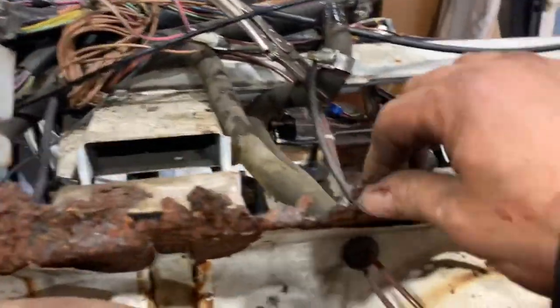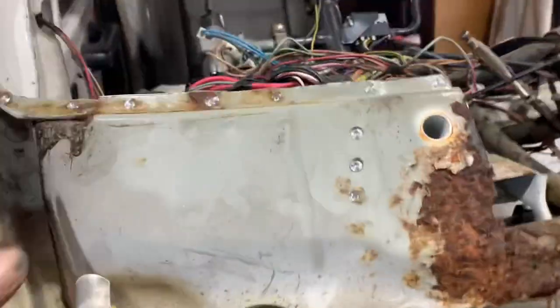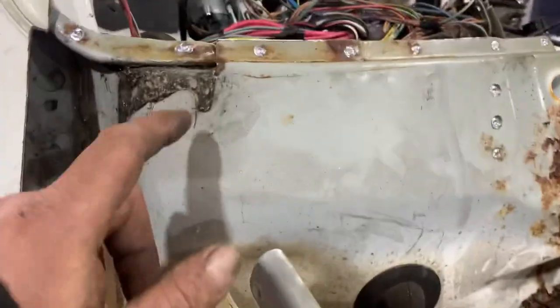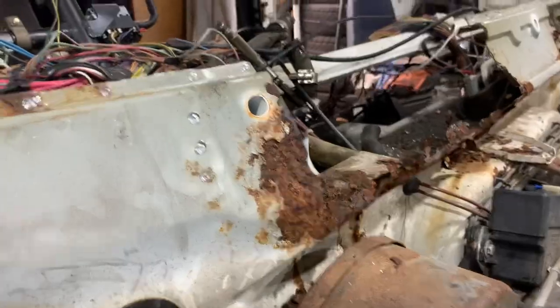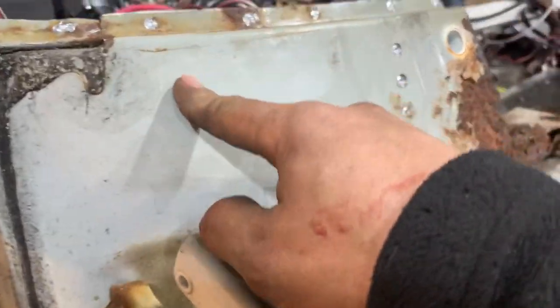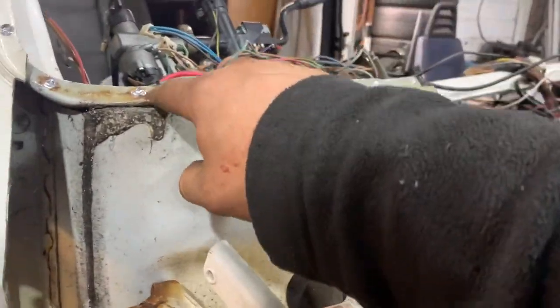I have just at the moment cut through here and knocked this section out because it is so bad. Strangely enough, we do have the original Mercedes factory book and there is a whole section on how to replace a bulkhead, because this panel basically is technically spot-weldable, drillable, and removable. Sadly, you cannot buy it anymore. So my cunning plan is we'll come through — there's a support rail on the back of here which was quite rusty in the middle, it'd gone here. So as I say, I've just cut it off for the minute. The panel join is in here, in the back.